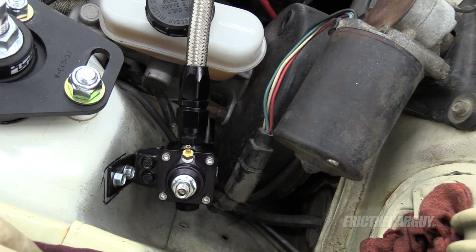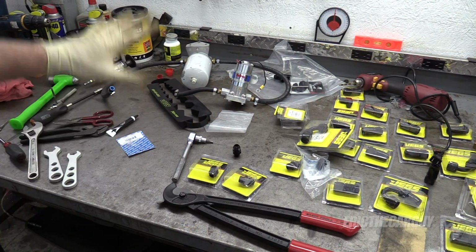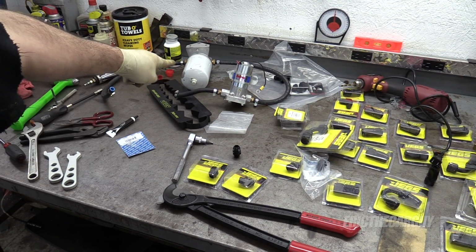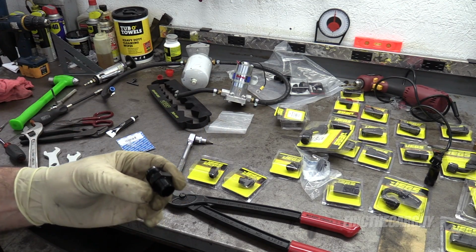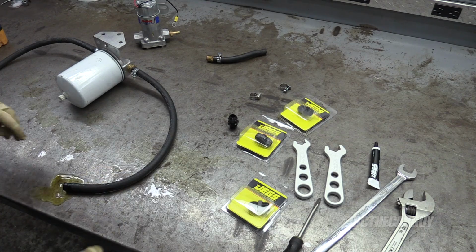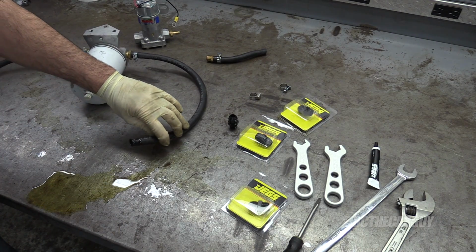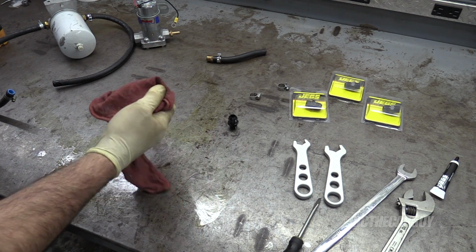So what do we do next? I think it's time to take a moment and clean off the bench. Then I'm going to install the fittings on the fuel filter and fuel pump. These 3/8 NPT to -8. Ew, that's gross fuel. Look at that. I guess we got to drain this filter out. Oh, this is rank smelling stuff.